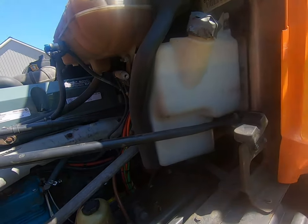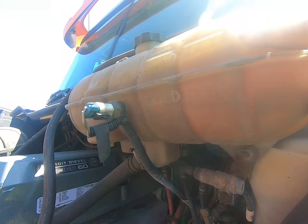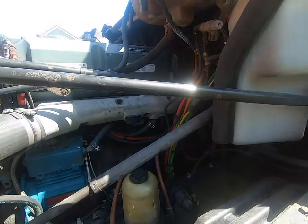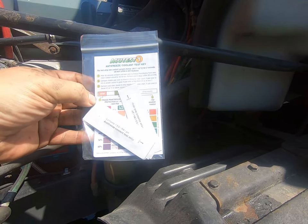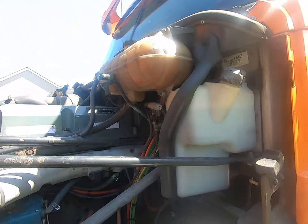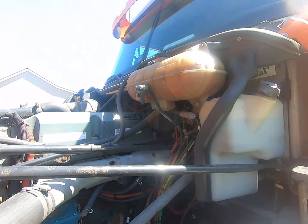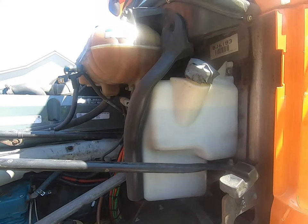Top off your windshield washer fluid, then your coolant. I run red extended life coolant in this truck and it's new so the quality is good yet. Check your coolant level, and in addition to that, depending on what kind of coolant you have, buy yourself some coolant test strips — you'll probably see them do this at the quick lube. Just dip one of these strips in, pull it out, compare it to the little chart, and it'll tell you your freeze point, the alkalinity, and whether you need to add some supplemental coolant additives. This red stuff is new, it's good for a long time yet, so I don't need any of that.